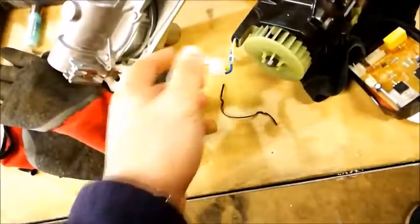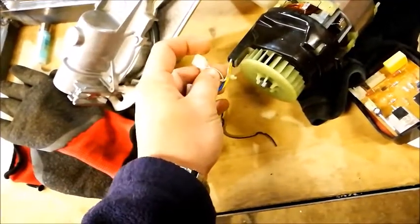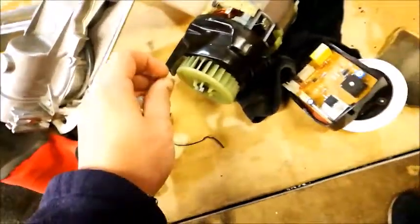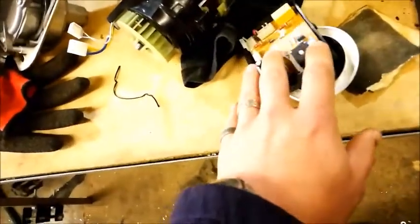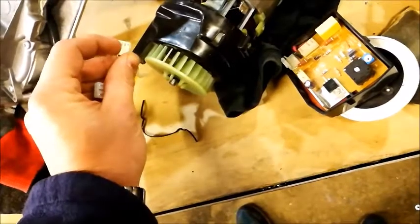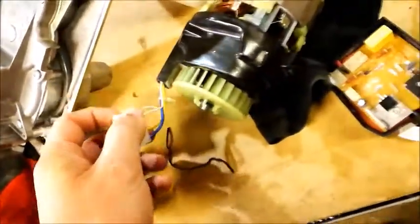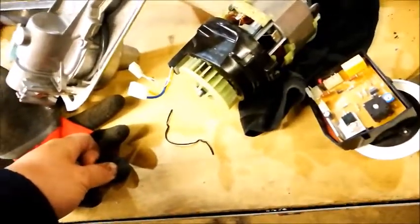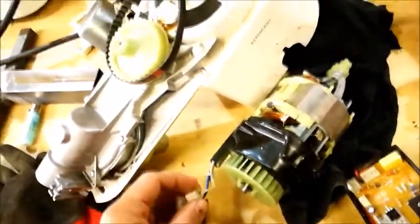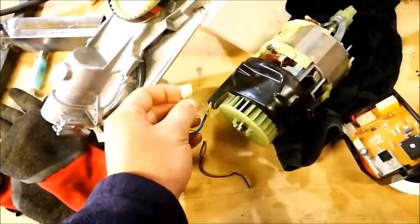I am expecting it to be some thermal switch, especially due to the thin wires. You can test on here and don't get any ohm reading. When everything was connected I even bridged it out when the motor was not working — bridged the first pin and the last pin — and the motor still didn't turn. There is apparently some expert in the UK that only does work on these machines. I mailed him and asked if he knew what it was, but didn't get any reply.